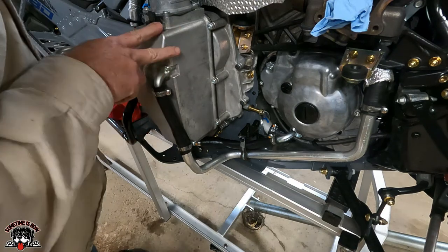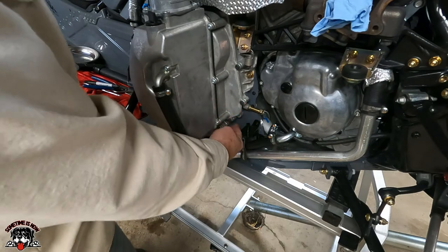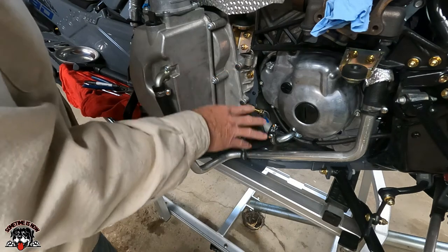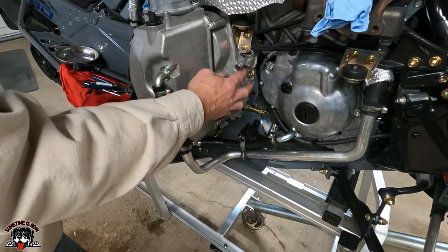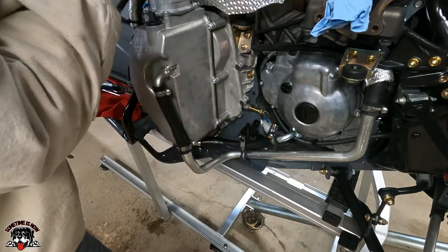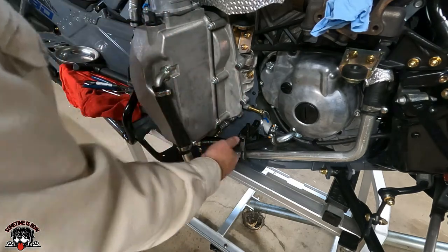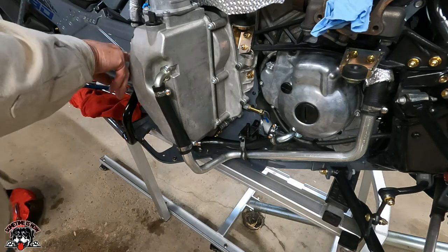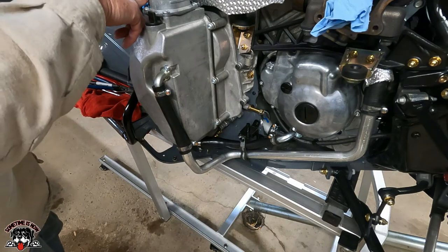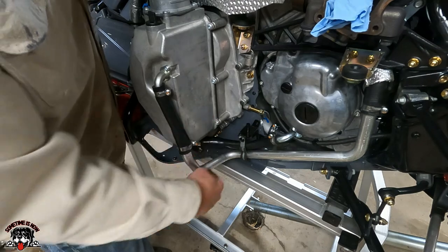Okay. We got our fluid in our chain case. All the black screws are all torqued to 12 foot-pounds. I didn't go any higher than that because 14 is too much, I think. Because I don't like the way the bolts feel, and I ended up snapping that one off. So those are all torqued to 12. Got these back. These three hose clamps are all torqued to 35 inch-pounds. Got all our wiring hooked up. Got our reverse gear set. Next we'll do, because we already got this oil tank drained and the lines.